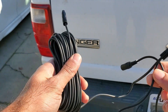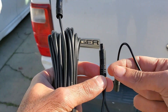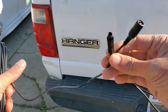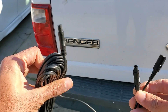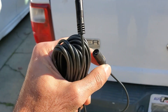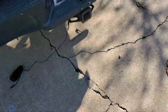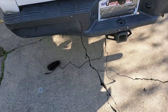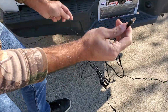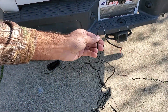This is one of the extension wires that came with it. It's got two ends: this end has just a four-pin connector, and this other end has a four-pin connector and also a power jack. So this is the end we're going to be connecting to our camera, and this is the end that will be connected to the monitor. We'll be connected to the camera and then this will be connected to the power coming from the tail light. So the power just plugs in here and we'll be using it to tap off from the reverse light.